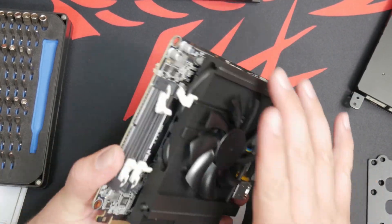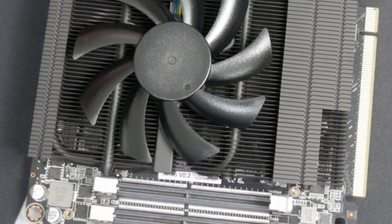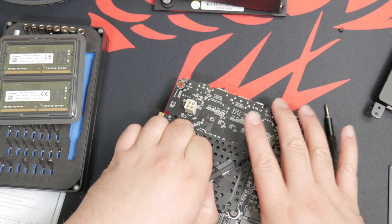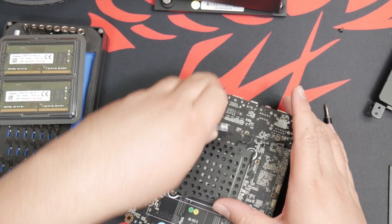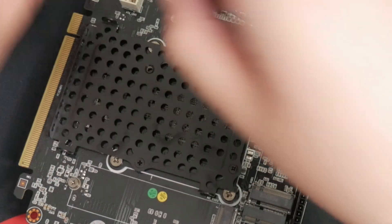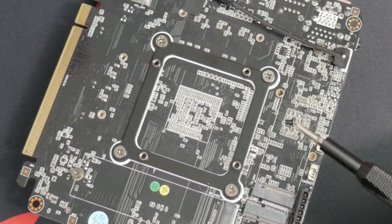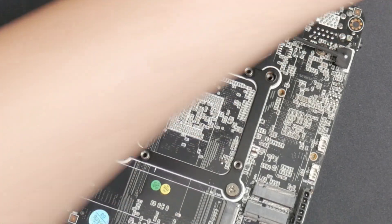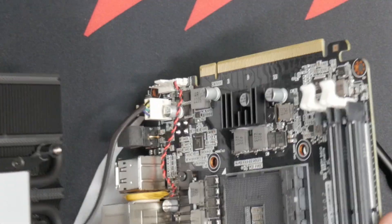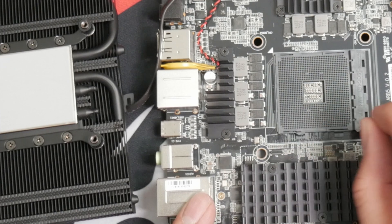Now take a look — there's the fan. There's our PCI X16 slot. The RAM would go here, and I have two beautiful Kingston RAM sticks that came from a laptop. The heat sink is held on with these screws — let's get to undoing all this. This shouldn't be on very tight since there's no CPU in here right now. Just like that. This cooling solution — I wouldn't trust it with more than a 65-watt processor anyway. Here's our AM4 slot — I'll put that in.